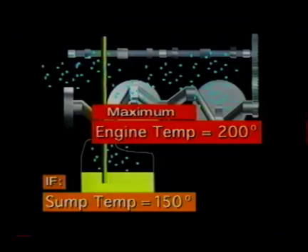a cruising oil temperature significantly below 180 degrees won't boil off moisture present in the oil. This is especially true during a short flight. At the hottest point in a naturally aspirated engine, the temperature is about 50 degrees higher than the oil in the sump.